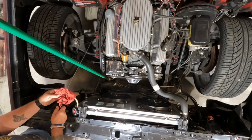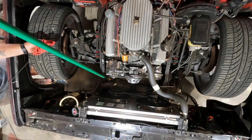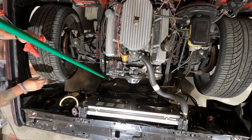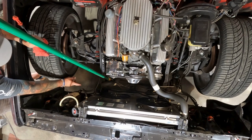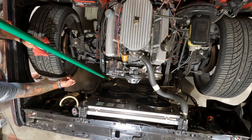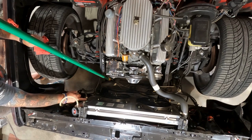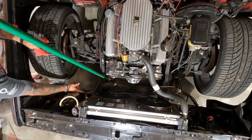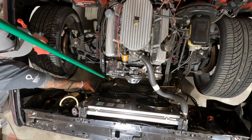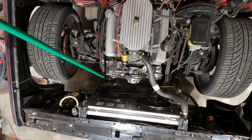Guys, I noticed something right after I shut y'all off a second ago. That I've got a leak down here. I'll show it to you here in just a bit. But there's 5 or 6 splashes down here, okay? Follow it up from the bottom radiator hose, red and gummy. I've got my transmission cooler lines, all of my transmission lines from the transmission, and I have a leak on this side, very bottom corner of this radiator.